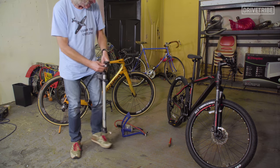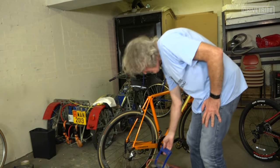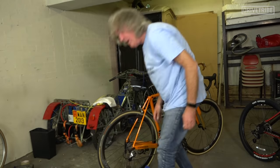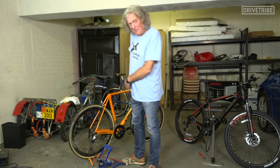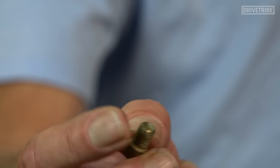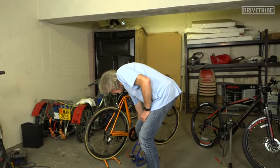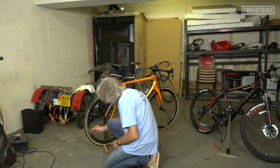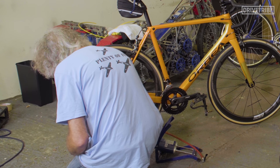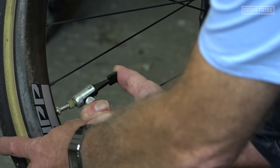Let's imagine you only have a standard bicycle pump or your old-fashioned car foot pump designed for Schrader valves — it's not going to fit on a Presta. What you need is an adapter. I always keep one in the little pocket of my bicycle repair jeans. It's essentially threaded to go over the Presta valve and then the other end is bigger to accept the Schrader pump. As before, undo the locking nut all the way, give it a tap to make sure it's free, then screw the adapter on nice and square — because otherwise as you tighten it up you'll screw the locking ring back down and then you won't be able to put any air in.